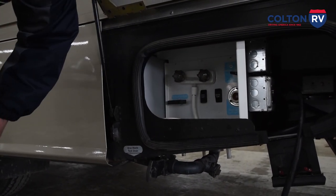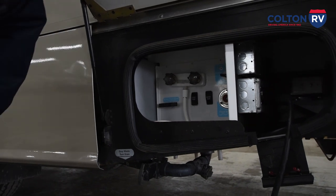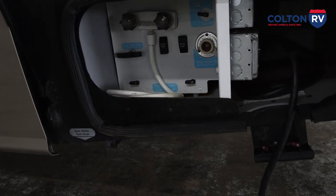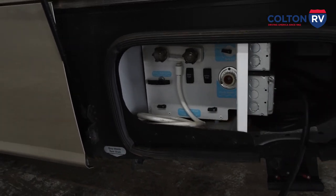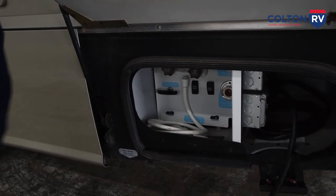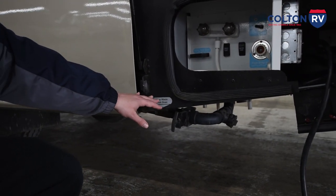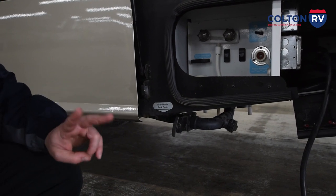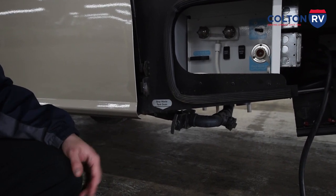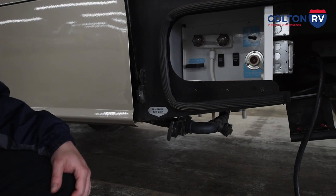The water tank drain is for when you're done camping and have water left over in your holding tank — this is what drains it. You pull that out and the water will drain. Also below that, there are two little knobs — turn them 90 degrees — that drains the lowest point in the cold and hot lines. Just like you don't want water sitting in your holding tanks, you don't want water sitting in your plumbing lines for more than 48 hours. When you're draining, you can turn on the drain pump and it will drain quicker. Your gray tank holds all the water that comes down the drains from your shower and your faucets and sinks. When you want to drain that, you pull this handle and down below is a cap you've got to remove to drain your gray water.